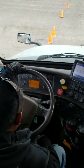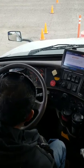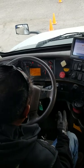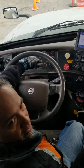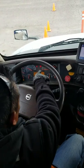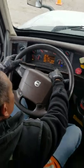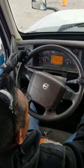Mr. Examiner, at this moment, I'm only concerned with four gauges, and that would be my oil pressure gauge, coolant temperature gauge, my voltmeter, which is digital. I want to make sure all these three are in normal operating range. The last gauges will be my air gauges. We know it's been working because we just got done testing the air gauge. Checking for my left turn indicator, right turn indicator, four-way emergency flasher, as well as my high beam and low beam. Okay. Now I'm going to go ahead and jump into my steering wheel here.